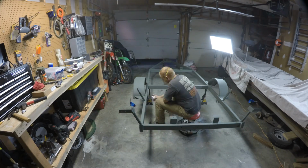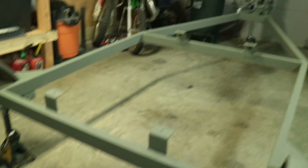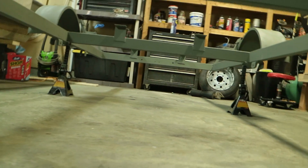So when you're putting on the primer, you want to make sure that you put it on really lightly and you want to do a few different coats. With this first layer of primer, you can actually make some mistakes and it not be too terrible. You can always go back and sand out the runs and the bubbles later on when it dries, and then just go ahead and put another layer of primer over top of it. Now after about 3 or 4 different coats of the primer, I would let it sit for a few hours to actually get a really good dry, and then you can go ahead and apply whatever color of paint you would like to use after that.